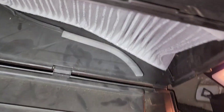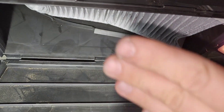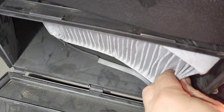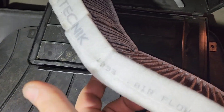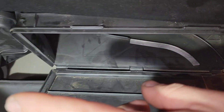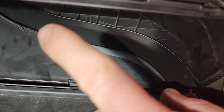As you can see, this is the cabin filter inside. It's sitting in a unusual place — it goes in like this, then inside, then up. This is the way it sits, so make sure you fit it back the same way it came out. It has a slot right there so you can pull it out the same way. The flow direction is down because it's supposed to go in the direction of the air conditioning, and that slot is where it's supposed to sit.